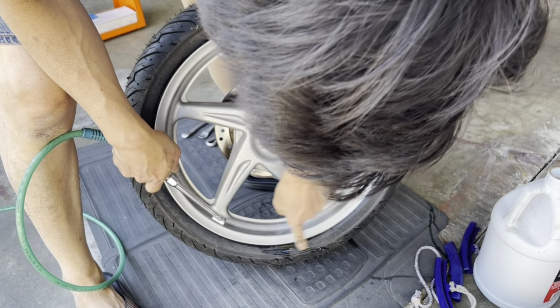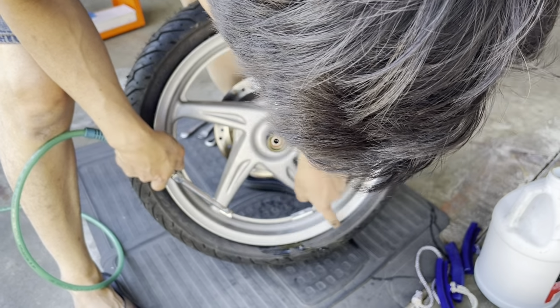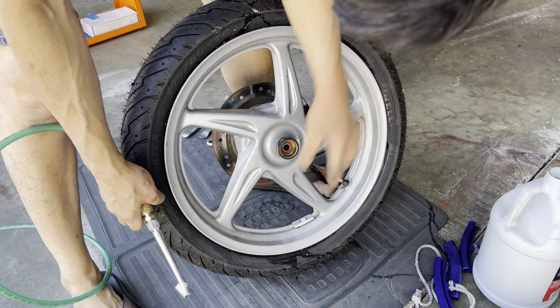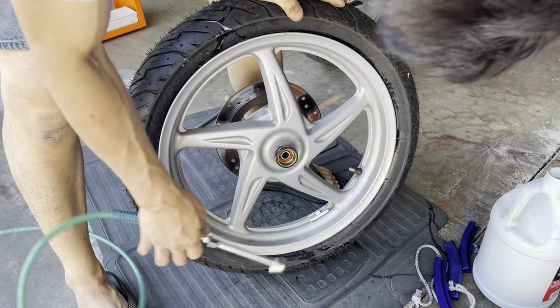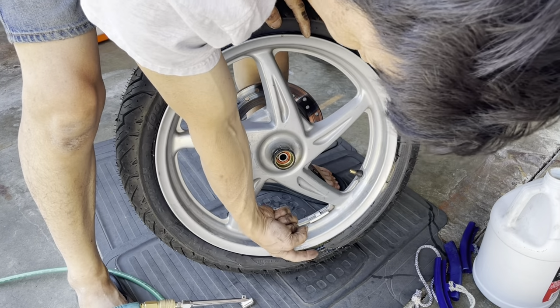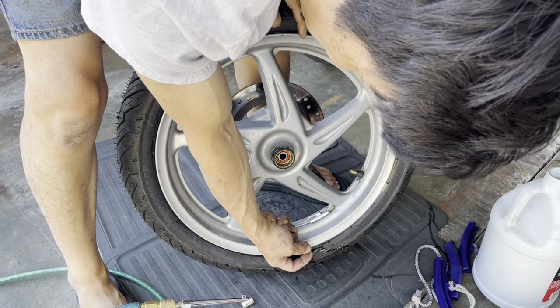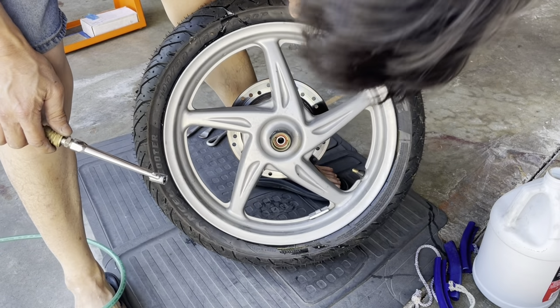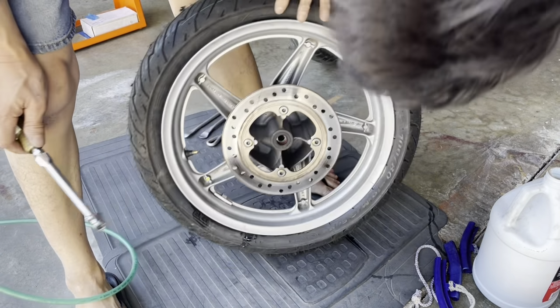Yeah, it was actually leaking somewhere around right here, and you can actually see the fluid come out. It was leaking around right here. That's the reason why I actually turned it. Usually wherever it leaks, if you turn it to the bottom, and you kind of push on from the top of the tire, whatever gap there is, it closes the gap, and it seals. And you heard both pops, right? Pop on both sides. So I'm good.